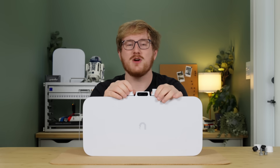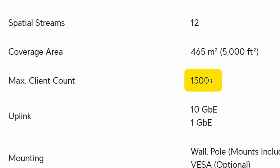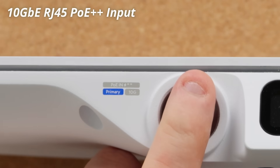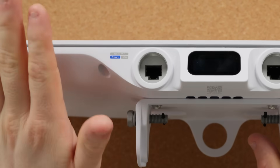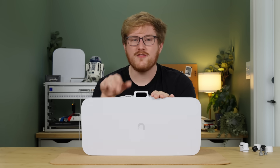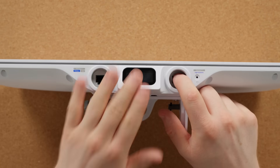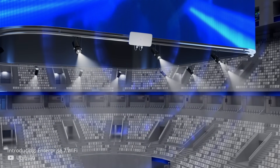Which is crazy — up to one meter for an extended period of time. They also rate this thing for 1,500 plus clients connected to it, which is a ridiculous number. And why? It has a 10 gigabit input — a PoE++ one to be exact. It also has a PoE++ one gigabit port for high availability, so if a cable gets cut or the switch has a problem, the AP will automatically switch over without any fancy LACP — it's really integrated into the device itself. There's also a screen on the bottom; I don't really know why, I guess just because you can at that point.